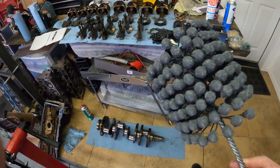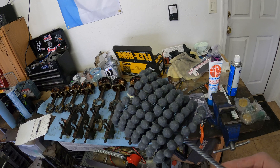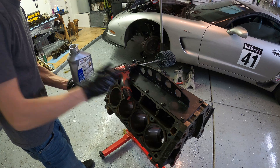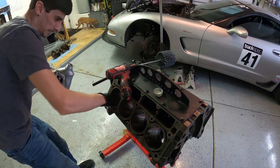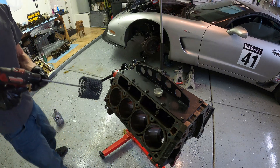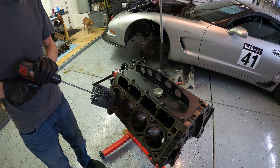You also have to make sure you lubricate the cylinder. They recommend using their own Flexhone oil, which is like a cutting compound, or you can use your 5W-30 or 5W-40. So we're going to take our motor oil, put some in the cylinder and some on the hone. You want to go in and out pretty quickly — they say the job should take about 25 to 30 seconds. Just keep going in and out, count to 25 to 30 seconds and you should be good.